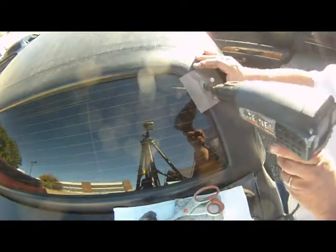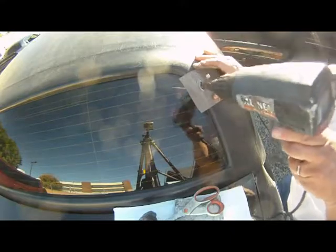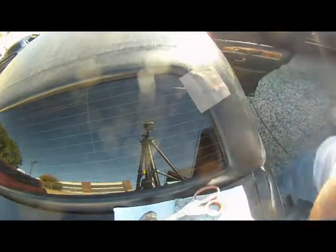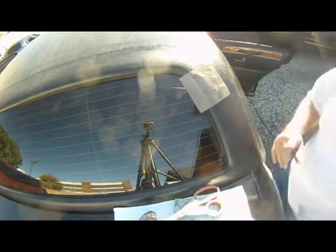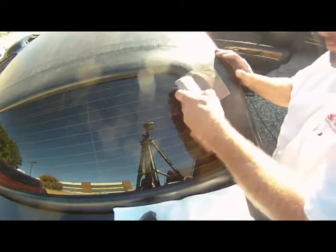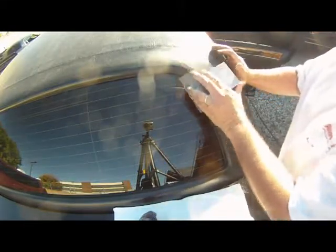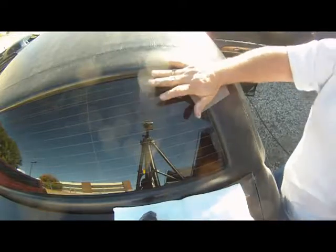So again, we're going to iron it flat — it should be glass smooth this time. If it is, then you're going to be pretty much done. We're just going to spray grain on it. As soon as I cool it off, remember to always cool it off or you'll pull the vinyl up with the Teflon or with grain if you're using grain. When it's dry to the touch, you can pull it out.